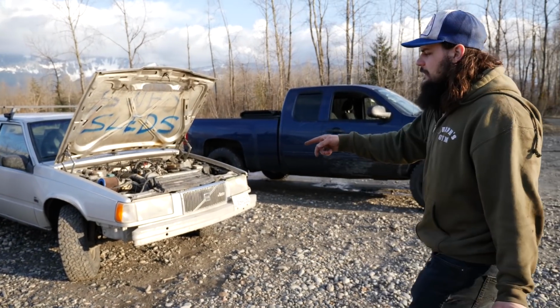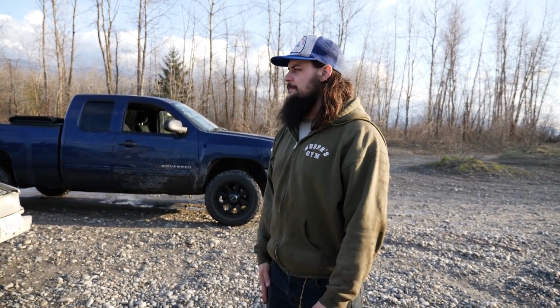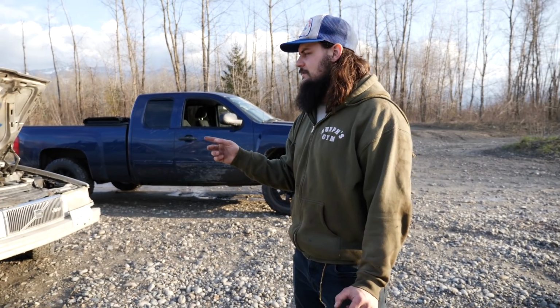So in the front, I did a different suspension setup. What I've noticed, river beating and taking them out on this kind of off-road terrain, it does not take long for the stock shocks to blow. They were good shocks when I put them in there, and within 2 sessions out here, a couple of jumps later, they were leaking oil pretty bad. So I put some Bilstein HD shocks in the front, and I also went with a stiffer spring.